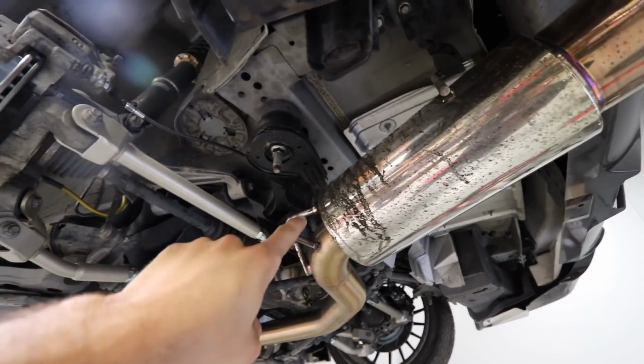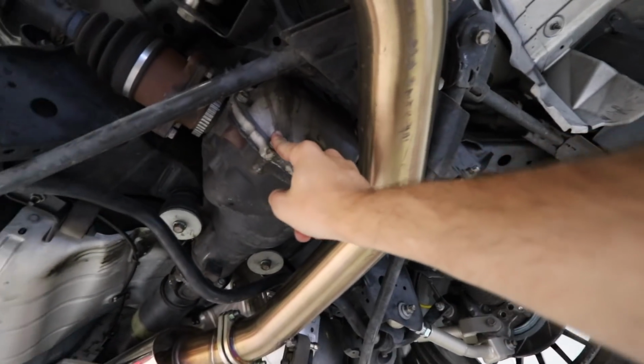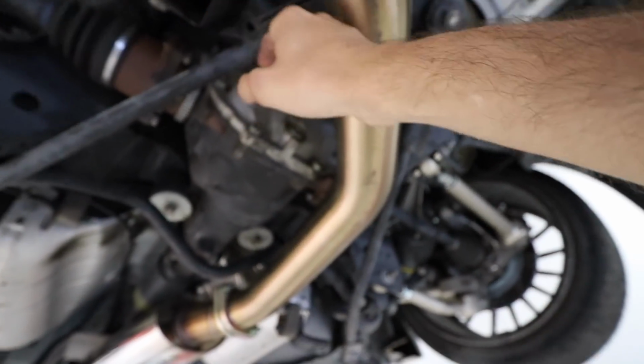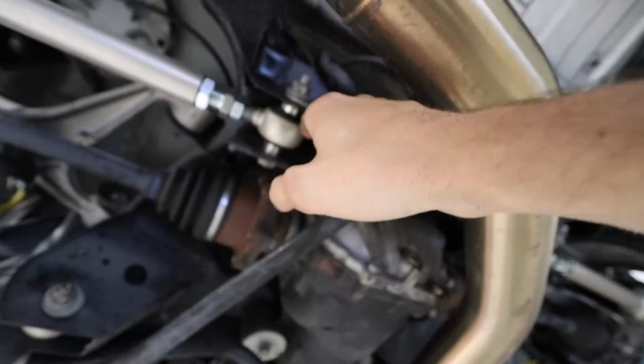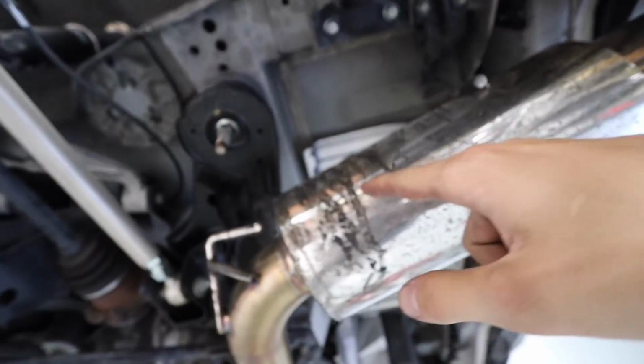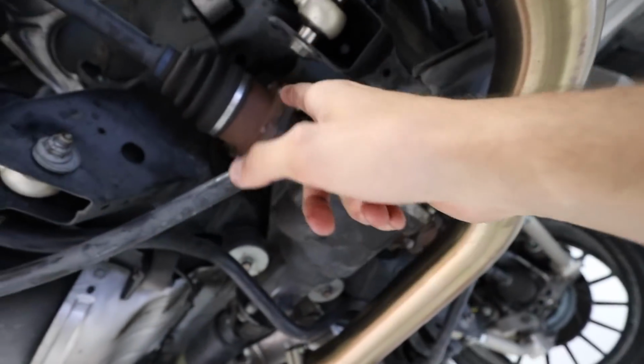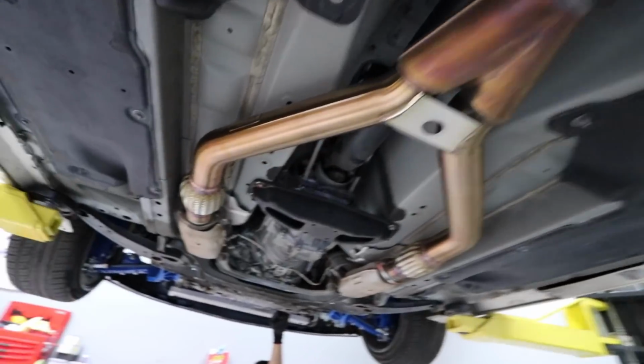All right, well, we're leaking all underneath the car. Let's put it up and see what it looks like. I noticed a whole bunch of leaky mess here in the back, and I was worried it was going to be the diff that was leaking. And it's not. That's good news. There's an overflow valve on the top of the diff, and the hose literally dumps out right in the subframe, which is why it's all leaking right here and getting everywhere. Wow, that is a real big mess. But that's a positive. I was expecting to see something bad or maybe a blown axle, but it's none of those things. Car's looking good.